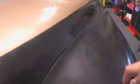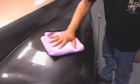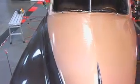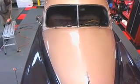And then a lot of times when I do stuff like this where I put a blanket over the engine, I take a post-it note and I tape it to the ignition that says, don't start the motor. Blanket on motor. Because the last thing you want to do is suck a blanket into an engine like this one. But that's because I always put the note on. I tell you, that is one mistake you'd only want to make once, especially on a real high-dollar engine.